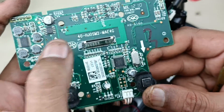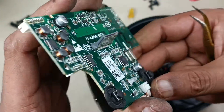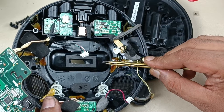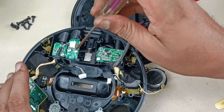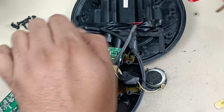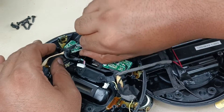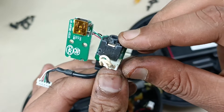Now let's see the other side of the motherboard up close. This is the iPod docking connector. These are the volume up and down microswitches. I am going to convert this speaker to battery-powered rechargeable, so stay tuned and kindly subscribe to Audiovis 360. I am going to remove these switches. This is the USB board and this one is the auxiliary input — audio in. There are two boards here: one is auxiliary input and this is the USB.